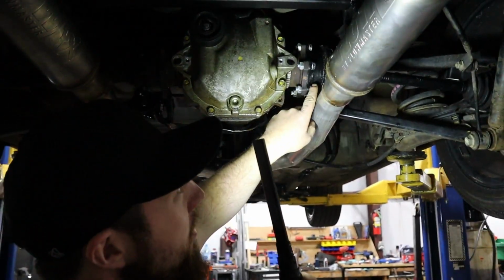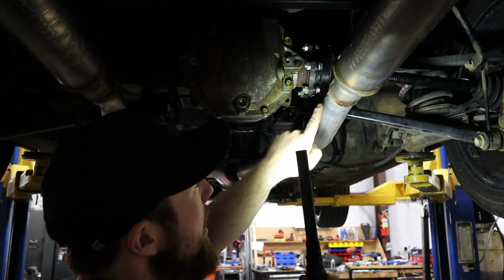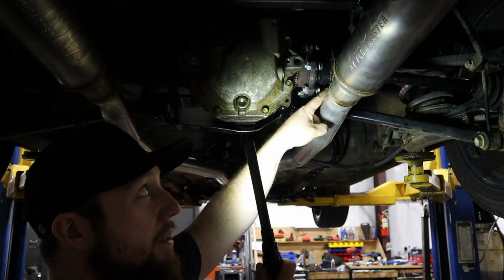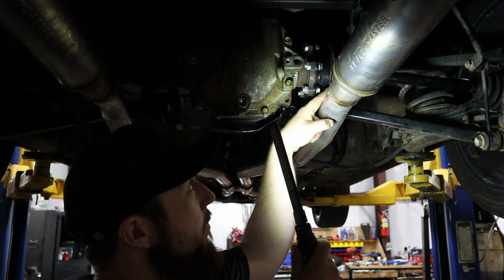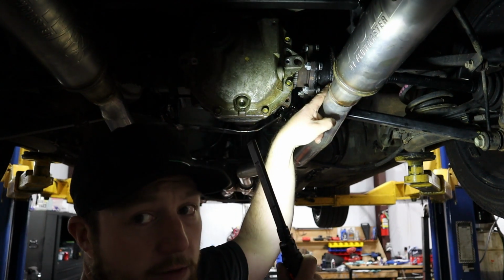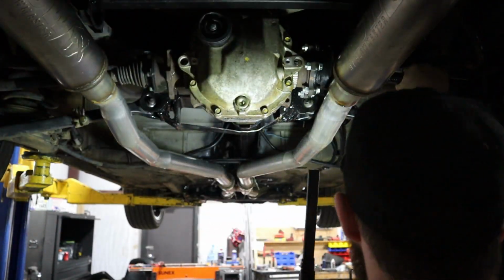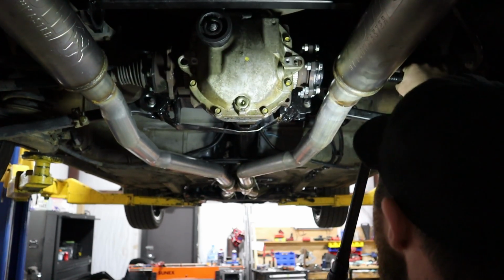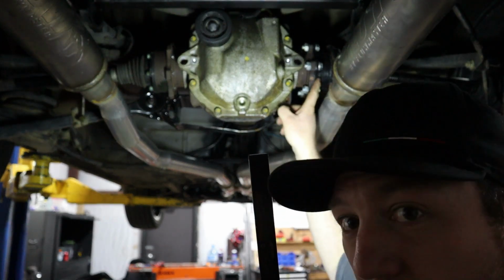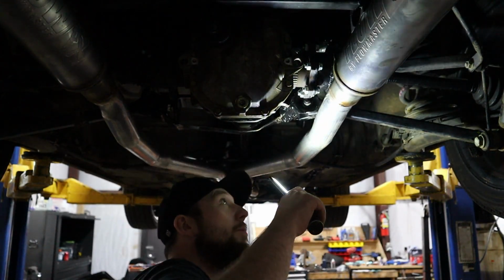On this side, I got me the drive shaft of a 370Z. I took the outer part off that bolts on here, and I had a big plate, quarter inch thick, made for here, welded on the flange from the 370Z drive shaft, cut threads in there, and bolted my original Audi drive shaft to this. So both sides, this one has an adapter, that's what I call it. And the adapter works fine, I hope.